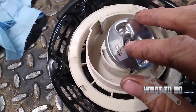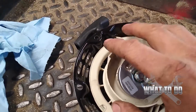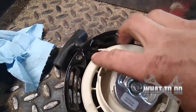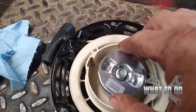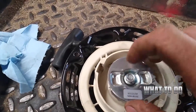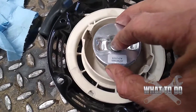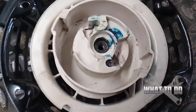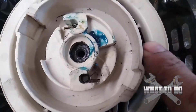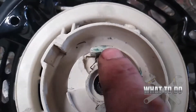So what you're going to need — I already took this one off — and you want to be careful if this is not broken already and your cord is still wrapped there, be careful that you don't unwind this. You're going to need a 10 millimeter ratchet to take this off here, and you want to be really careful because there are little springs underneath. If those springs are missing, these aren't going to work.